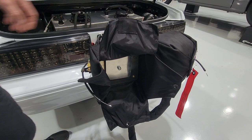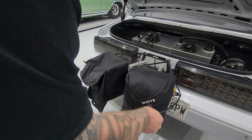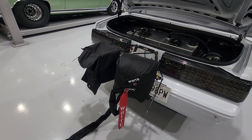That's your CO2 plumbing for your parachute. Before you repack the chute, throw your handle back in so you can slide the thing out. White Safety basically told me that 100 psi on the back of these cylinders just wasn't enough, and 200 will do it. Those cylinders are rated for 350 to 400 psi, so we're nowhere near maximum pressure. We could run it up higher with that regulator if we wanted, but I think 200 is more than adequate.